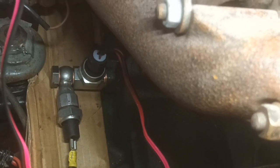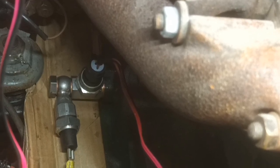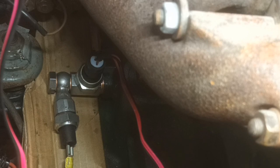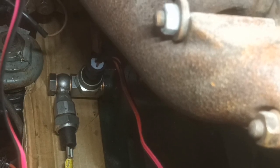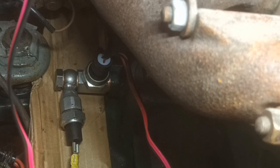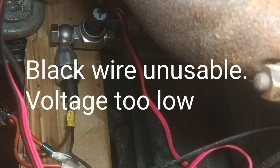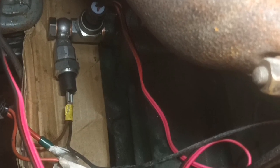I had to make a banjo - you can buy banjos plain without any ends on if you like - and then I made that nut with an M12 by 1.5, which is what the Simca oil pressure switch takes. Although that isn't a Simca switch, that's a BMW switch, but it does the job. I've put two wires coming off that: the brown one is the feed to the lamp, and the black one will be for the alternator.